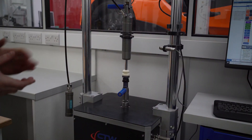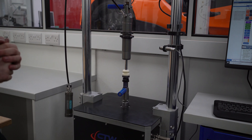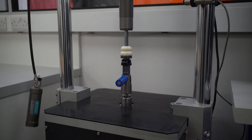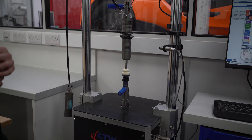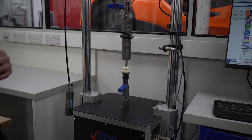What's currently going on with this damper? Basically it starts off cycling at 100 millimeters a second, then gradually works up in 100 millimeter increments up to 1500 millimeters a second, and then it records the force at each of those velocities.